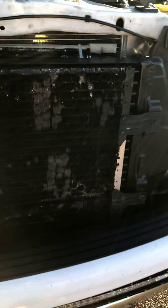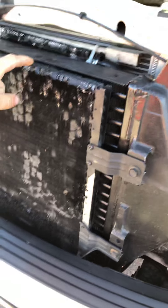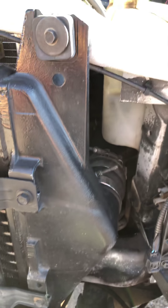What you're going to want to do is take all the front coolers off. The AC condenser comes off — you got four bolts right here, those come off, you remove that. Then you remove your intercooler brackets right here that hold it down, remove the couplers from each side, and once you have that removed you pull the intercooler off.